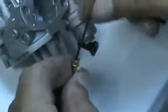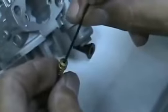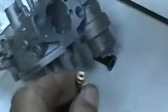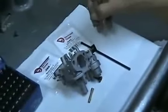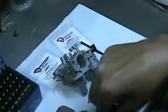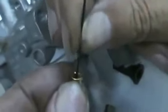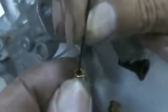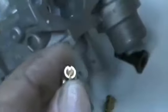This is the 066 no-go gauge that cannot pass through the center part of your E-tube. That is your no-go gauge — it's a 066. Now, an 042 here is your no-go gauge for the jet. An 042 cannot pass through the jet — you can see I cannot stick it through. This is just a straight stock jet that I'm using as a reference. Of course, you drill these.